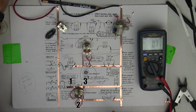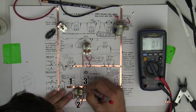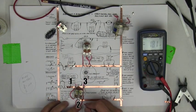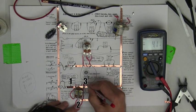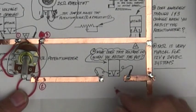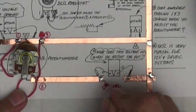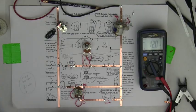This would be terminal one. I'll call that one, so that's terminal one, that's terminal two. And don't forget, the whole point of these cards is you can write on them. See, I was wrong with that — everybody makes mistakes, right? That's terminal three. This is going to be terminal two because that's the signal. So this is the signal right here, and this is what would be going into the ECM or whatever. So there's your signal.